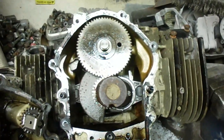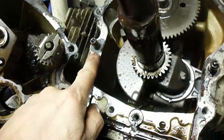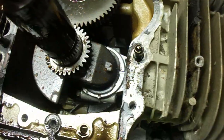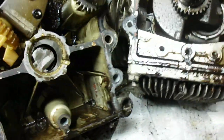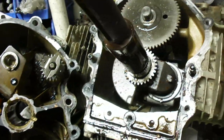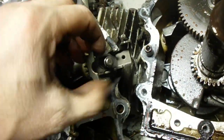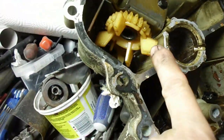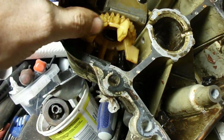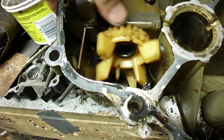I've removed the bottom cover. It's got six bolts in it and a couple of dowels. I put penetrating oil on them and then there was just a bunch of smacking on the four mount feet that it bolts to the mower deck with. There's a little piece of the governor that fell off into the crankcase — I can see it down there. Interesting thing here: the oil dipper. It's a two-stage thing. There's a second dipper down at the bottom that turns the opposite direction. I haven't seen one of them before.